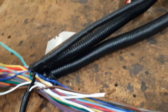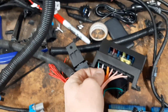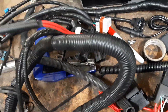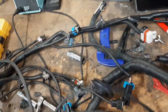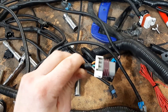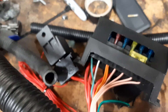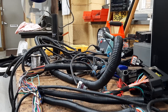The second issue is with the power from the fuse block being shorted to the MAP sensor plug. On your MAP sensor signal wire — okay, so here we are right here — you've got your MAP sensor. See that center pin there? That is the actual signal wire, and that is actually shorted.